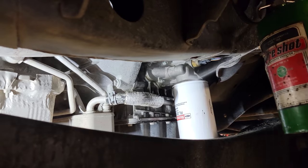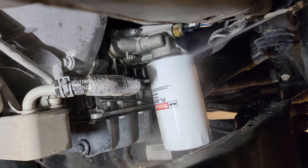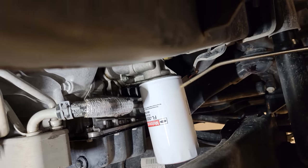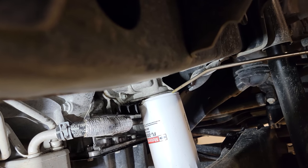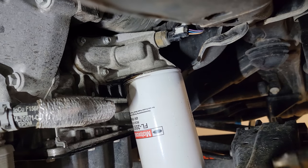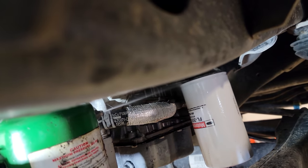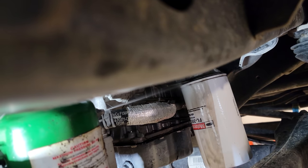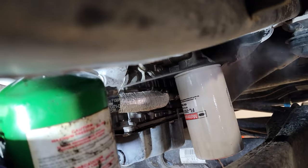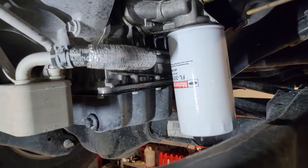Right there in the crack — right there. Flush all that oil out that was leaking while I was putting the filter up. And then when you're done, let it cool. Look at all that oil — all that oil blew out. You repeat it. You guys can see it's still stained on the side. Repeat that same process until you have no more. I'm flooding the oil all the way out with fresh brake clean. All that would be sitting and looking just like the filter I pulled off if you wouldn't have cleaned it.